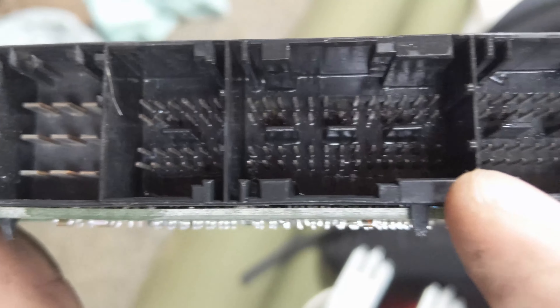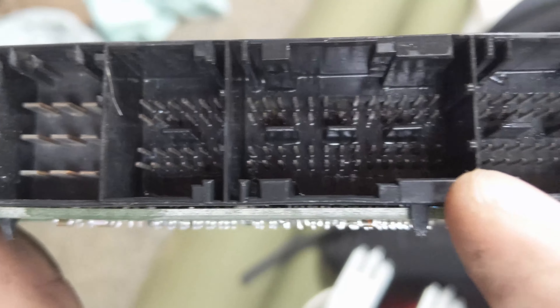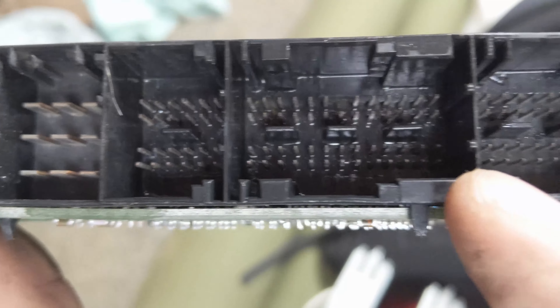So this is the ECU. I just opened it up. This is located just under the dash to the left of the driver's seat. Immediately when I opened this up there was some corrosion in here which I've already scrubbed up a bit with some vinegar. I was kind of surprised that the previous owner hadn't really inspected this, since the ECU is one of the prime culprits.